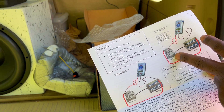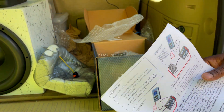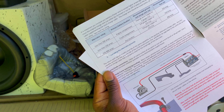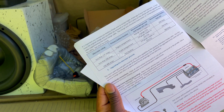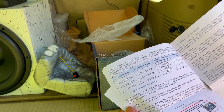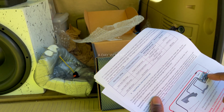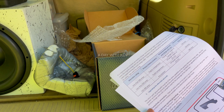Your ground wire goes to your ground area, wherever your ground is, and your power wire goes to your alternator. They tell you to use a fuse within 12 inches of the battery, between the battery and the alternator. I really didn't know that, but that's what they're saying to do right here in the instructions. Got the ground wire here, and of course the battery connection.